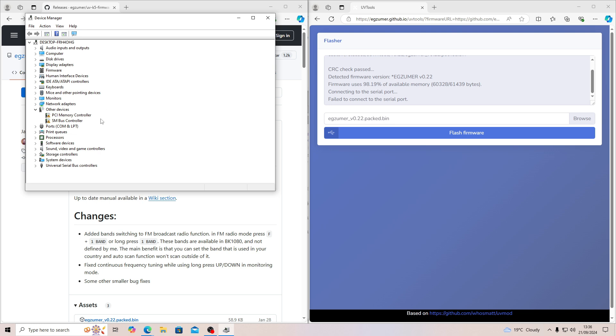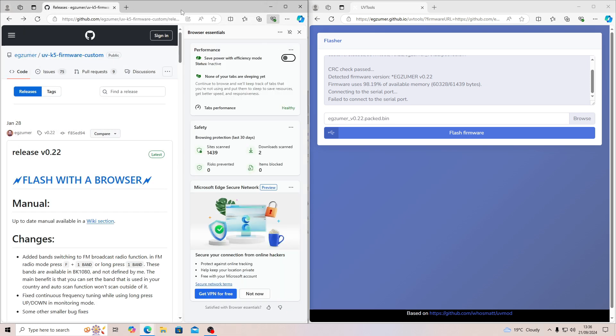Come over to the Windows panel in the left corner, click on Device Manager, and look for something called Ports. In my case I've got a Prolific USB to serial COM port on COM3.